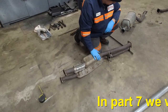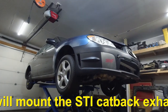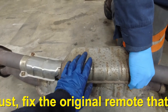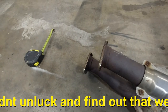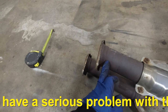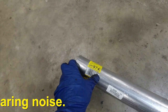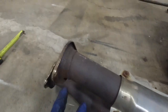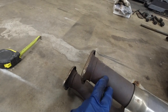Alright boys and girls, we're doing the exhaust. We got all the pieces — the bottom piece here, that's the mid pipe, that's the 2.5 stock. This is the 07 STI stock. As you can see, it's a little bit 2.5 inches short, so what we need to do is cut it right here and simply add 2.5 inches — well, we're gonna cut probably 3 inches or so.